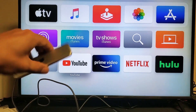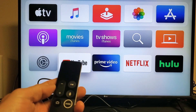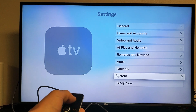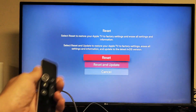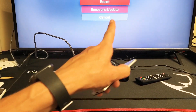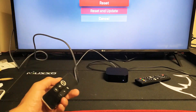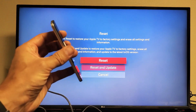If you have the new HDMI cable and are still having issues, or you want to try one more thing, you can do a factory reset. Grab your remote, go to Settings, then System, then scroll down to Reset. Keep in mind that a factory reset will reset your Apple TV back to factory default settings — it'll be as if you just bought it brand new. You'll need to pick your region, enter your Wi-Fi password, sign into Hulu, and start from the very beginning. Let me know which step worked for you.